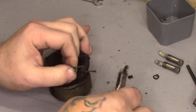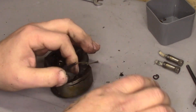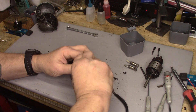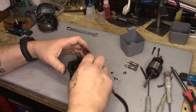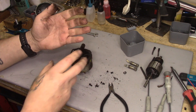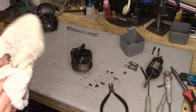I'm going to strip this back also in small bites. Note that they were pointed in that direction — keep that in mind as we go. Strip this back, get this crap off, strip it back. Let's twist these nicely together. These wires that go to the brushes I'm going to leave alone — they look to be in pretty good shape, which is usually the case.